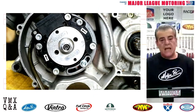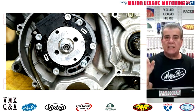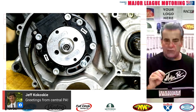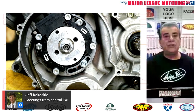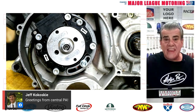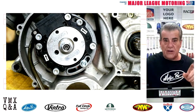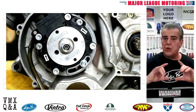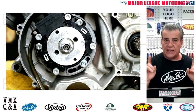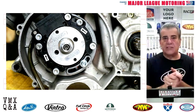You can see it right here around the edge of that rotor, right where those black legs are with the two arrows on them. It needs to be ten thousandths of an inch clearance all the way around. What is ten thousandths of an inch? It's a piece of paper folded over, or two sheets of paper — that's how much clearance you have between that rotor and those legs from the stator. That's why they put that tape around there. When you put it together, that tape should not be hitting any place on those plastic legs. Don't take the tape off; make sure you have the clearance when you put everything in there.